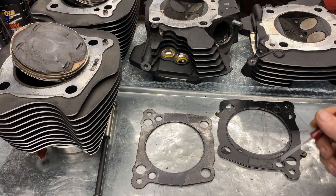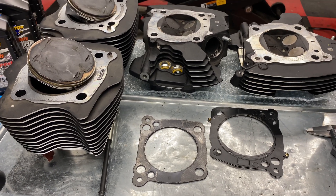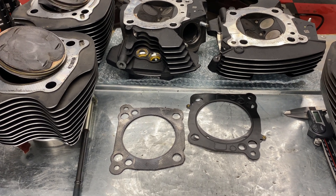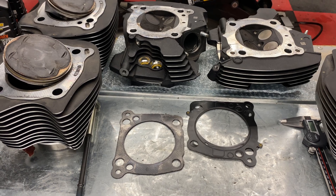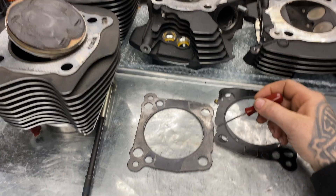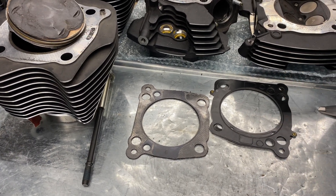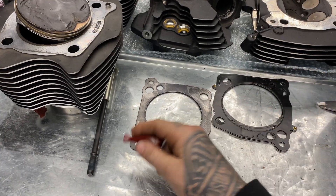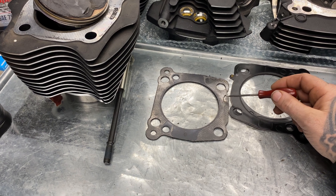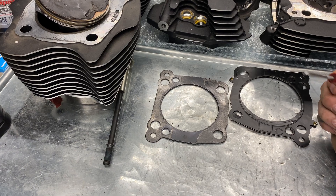I'll explain what goes on and what causes this, because there are differences on the head gasket itself letting go and failing through different reasoning based on engine behaviour. The composite head gasket on full squish or full tension with the cylinder head and cylinders torqued down via a stud and cylinder head bolt — there's 74 thou in that which I've measured with verniers. Quite a thick head gasket.